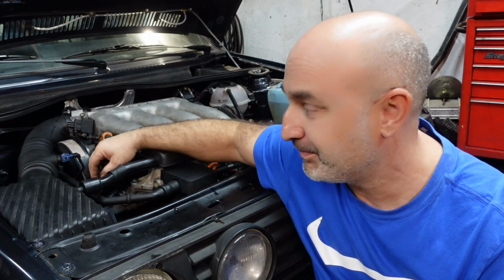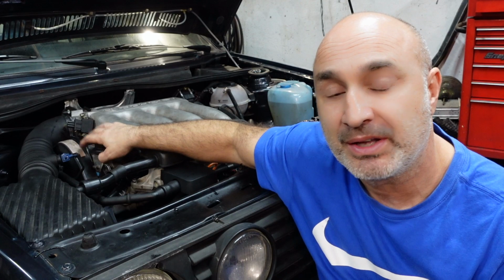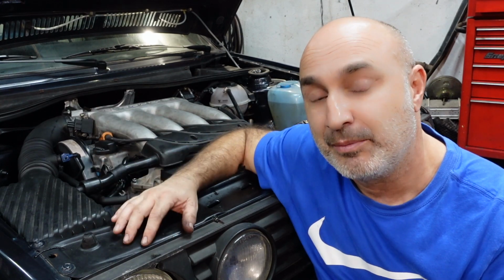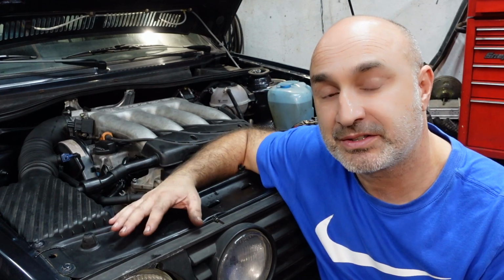All right, so as you can see, all completed and done, bolted up, ready to be started. Now, I'm sure you saw I actually fitted a different cam pulley. It's called a cam vernier. They're adjustable. This one's actually by Piper Cams from the UK, and that's going to be in the next video, guys. I'm going to be putting this on the rolling road, mess around with it, get a baseline, and then actually advance it 1 degree, 2 degrees, 3 degrees, and then retard it the same again, 1, 2, 3 degrees, and actually see what kind of power it gets.